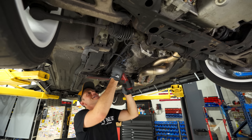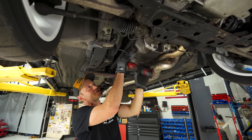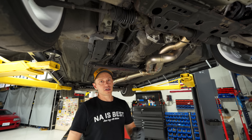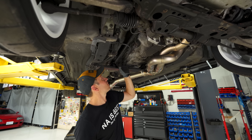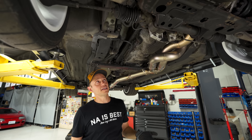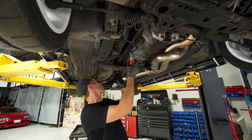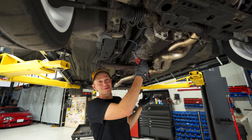For this car to be put into two-wheel drive mode it is not like the R32s — you guys can correct me if I'm wrong in the comments — but with the R32 all you have to do is pull a fuse and it switches over into a two-wheel drive car. With this one you have to pull the center shaft here; there's no actual way to do it without that. I don't think there's going to be much fluid that comes out because I don't think we're the first people to do this.